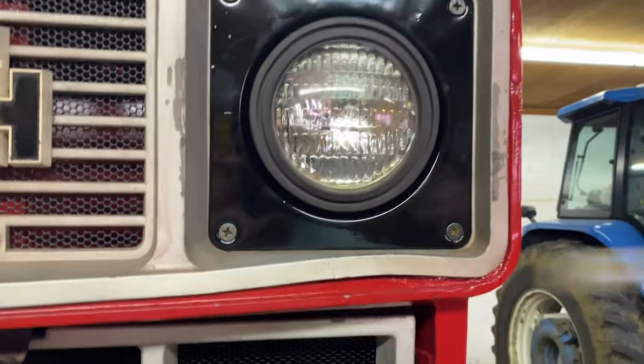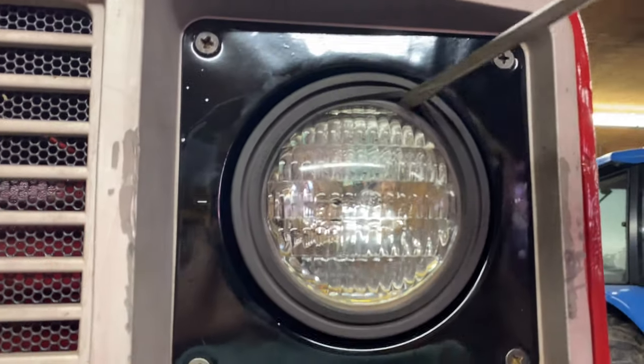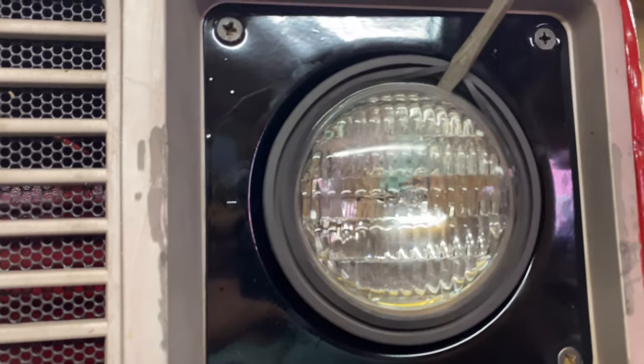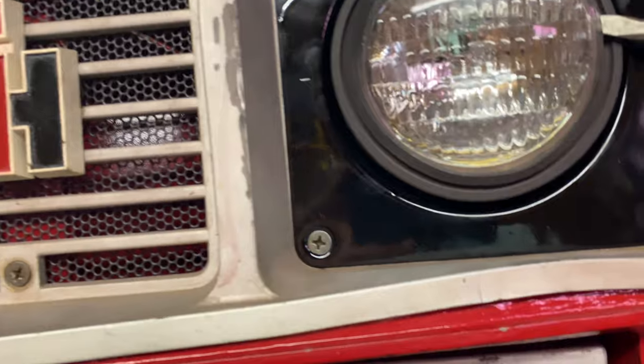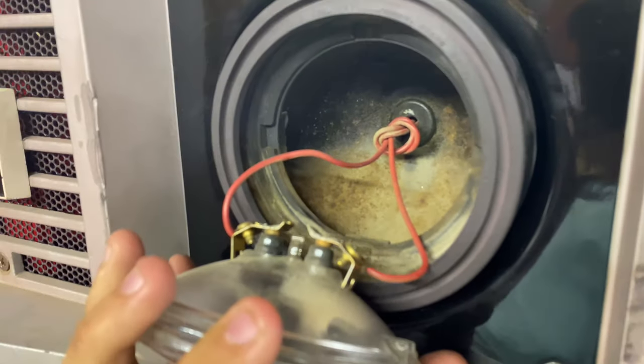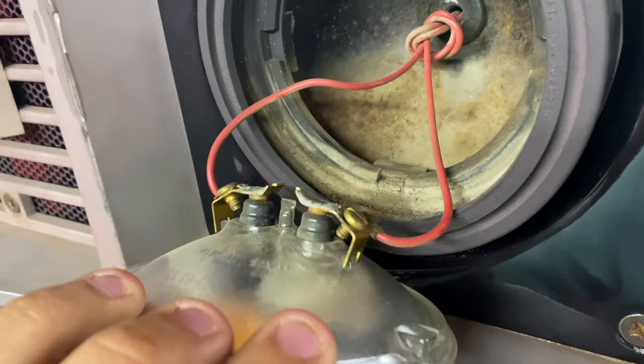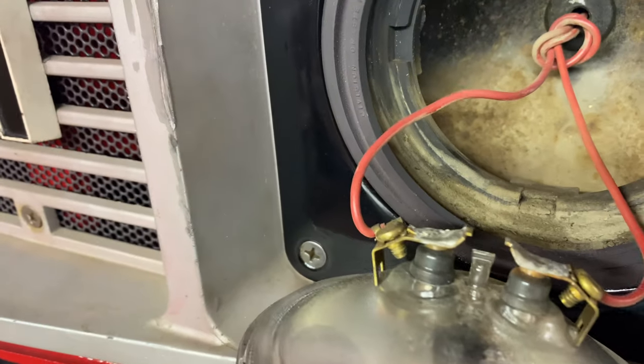Installation on these is pretty simple. You're going to grab yourself a screwdriver — take care, old halogen lights like this are glass. Put your screwdriver up in here; this is all rubber so you're just going to go up in here and slowly pry out, being careful not to bust the bulb. As you can see, I've gotten it out quite a ways — I can grab it with my hand now. And bingo, that is your bulb pulled out. Now you're just going to unscrew these little fork things.